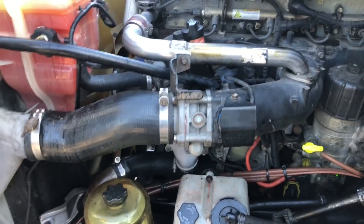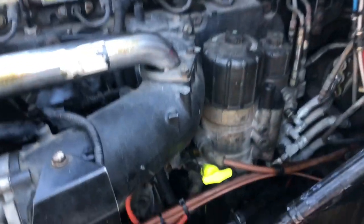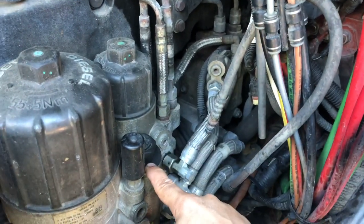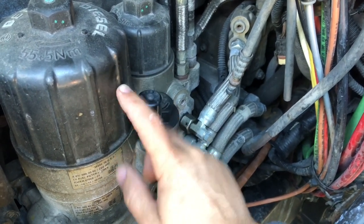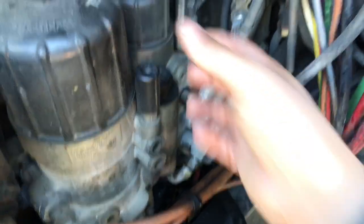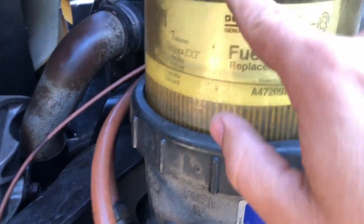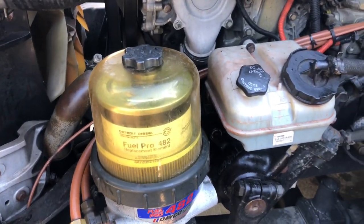Okay, so the truck ran for a few minutes, we got it good and greased up. Now it's time to change fuel filters. What you do is come over here and unscrew this bad boy over here. That's three — on a 2012 I got three filters. And I believe 2013 and up, maybe 2014 and up, they eliminated this one and you got only two. On the older one you got three filters plus you got this water separator. I don't need to change it yet because the change line is all the way over here — I don't know if you can read it, it says 'Change.' But I'll go ahead and do it on this video so you guys know how to do the full PM service on your truck.